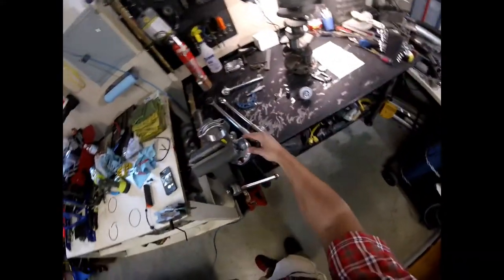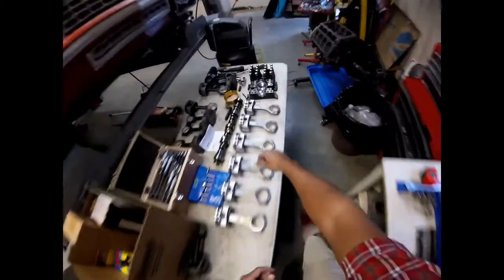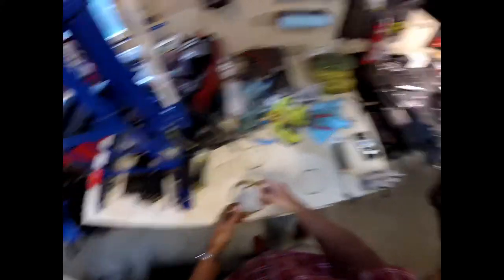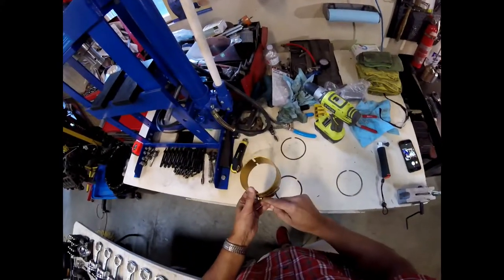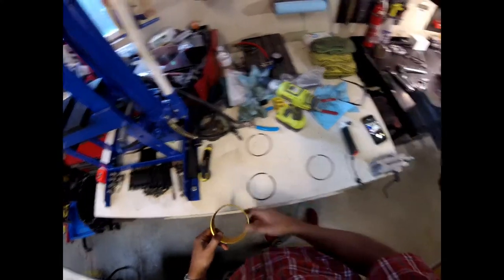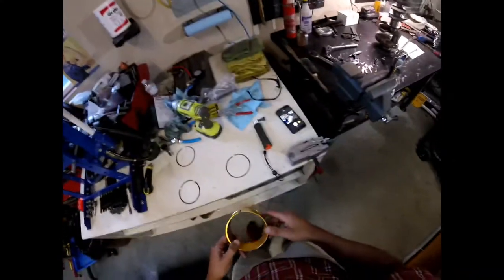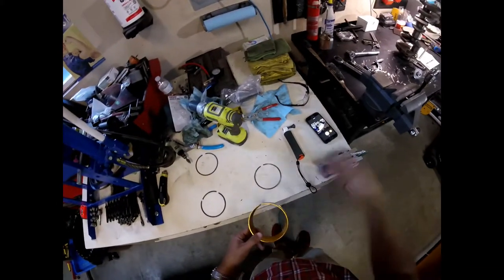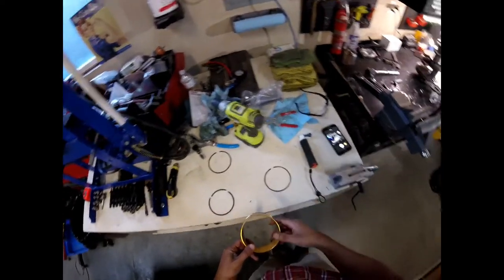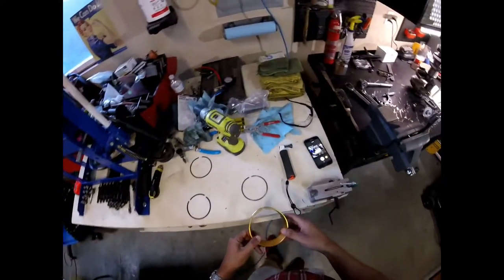So this is number one piston and rod. What happened was I tried to fit it in the cylinder using my ring compressor, but I didn't lubricate it — that's a good tip, you want to lubricate it and make sure it's the right size for the bore. Because I didn't lubricate it, it got caught up and broke the top ring. So I'm just using the factory chrome ring, which should be fine since we're going to run a lot of boost and nitrous. It already had a 34 thou gap in it. I'll talk about that when I cover the gapping in the next scene.